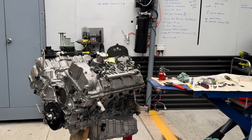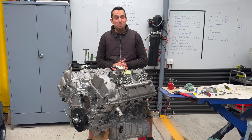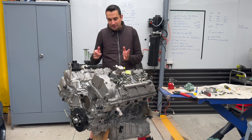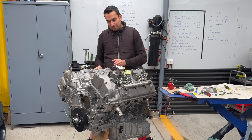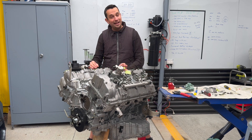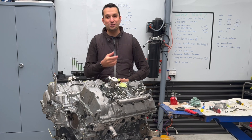Unfortunately I didn't have a chance to record installing the valve cover and a few injectors — life got in the way and next thing I knew the engine was back in one piece. For the valve cover, it's just a bunch of bolts torqued to 10 newton meters, replace the rubber gasket ring, put it in place and tie it up — not much drama to it. Same thing for the injectors: we replaced the seals, the decoupling elements, slid them in place and torqued the brackets to support them. I hope this video was helpful — as always, thank you very much for watching and I'll see you guys next time.